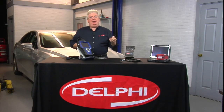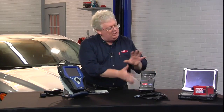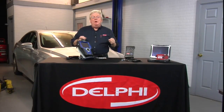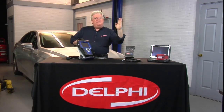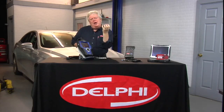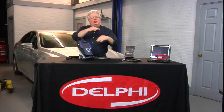Other scanners that do Mode 6 include Toyota TechStream, a PC-based factory scanner that can be put on the Panasonic Toughbook with a special VCI, or you can use your own J2534 universal reprogrammer — whichever brand you have — as the pass-through between the Toyota, Lexus, and Scion vehicle and your laptop. It not only does factory scanning but also does a really nice job on Mode 6, complete with a color-coded bar that visually shows at a quick glance where the parameter fell when that monitor ran.